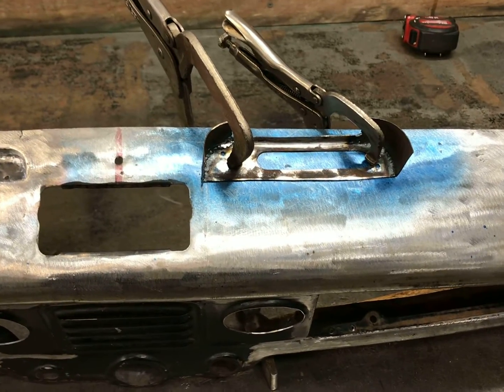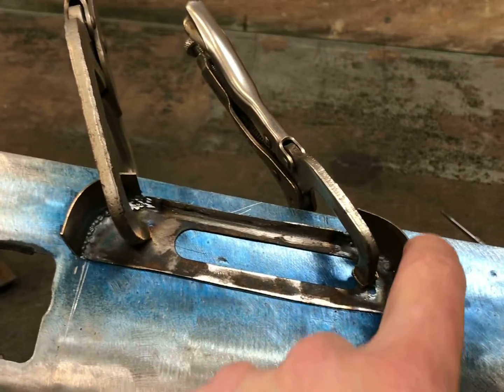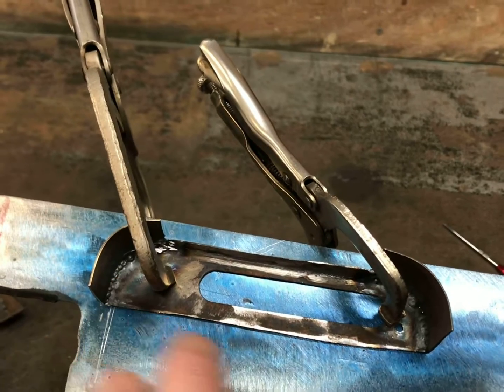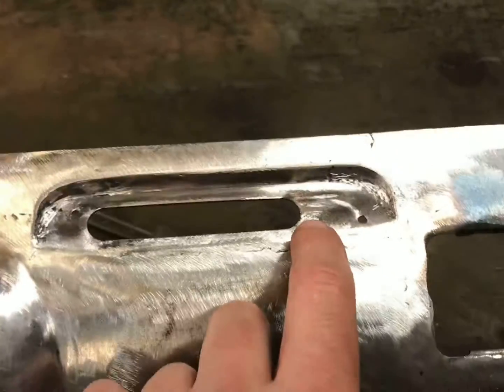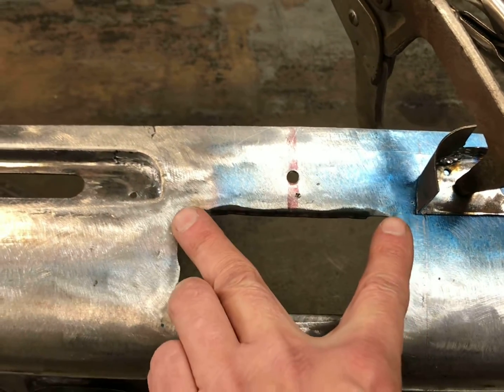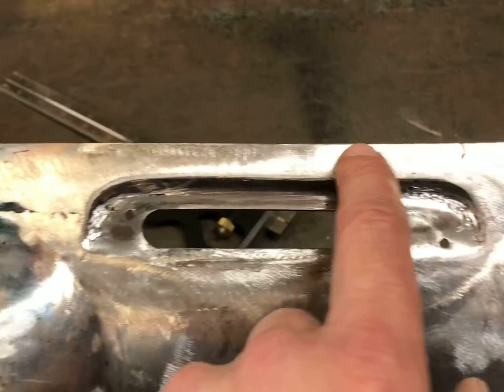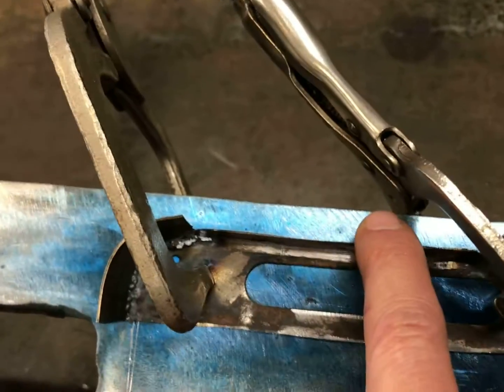There, guys, I want to show the recess here. I got it made. Just welded these two pieces here on the side to give it that curved look there. As you can see in the other one, it did the same thing. So I got it on there. I measured my distance from here, roughly 3/8 of an inch off the ashtray. Kind of found that edge there. Also this edge here, 1/2 inch off the front of the dash.